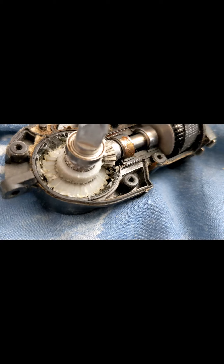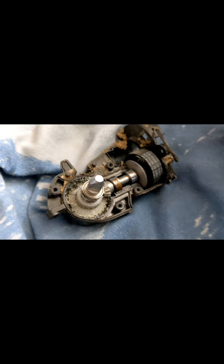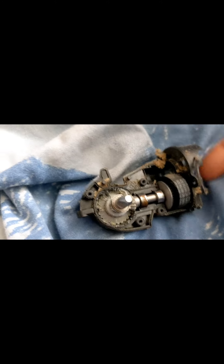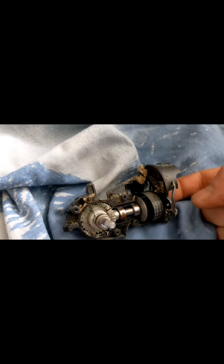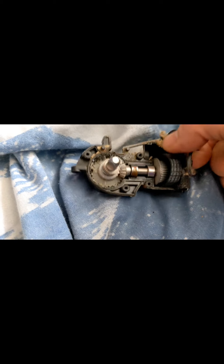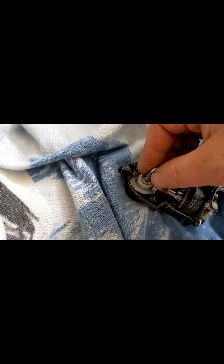Dad, I thought you'd appreciate this. This is out of the hoover that you were looking at. The motor and its pinion - that goes in here. In this end is the band, so it's a band-driven one. We've got this - I don't know, would you call that the drive shaft? I'm not sure, but this is I guess the gearbox or the differential. It's this that's stripped.